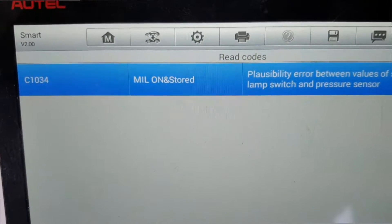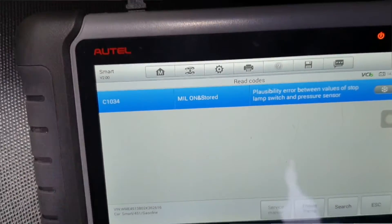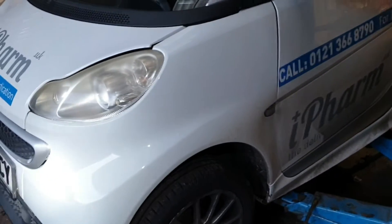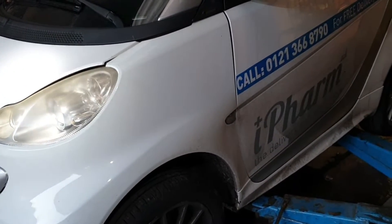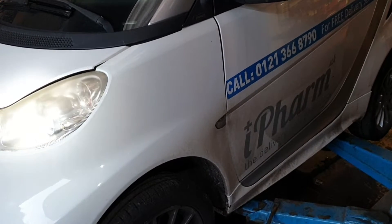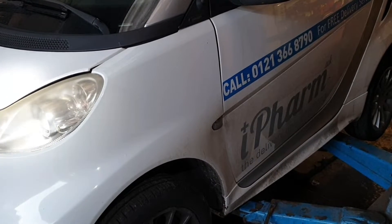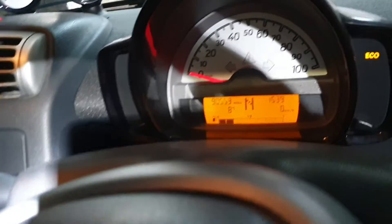You may or may not have this fault code. But anyway, if your brake lights are not operating and when you put the gear shift lever to R position or reverse gear position and the R is not registering on the dashboard, it's going to be the brake light switch located on the brake pedal.